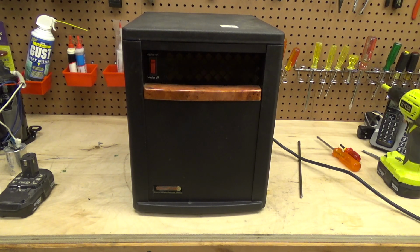It's fairly quiet. The serviceability, not bad. The case got a little confusing towards the end, but overall it's not bad. I really like that the inside is all encased in metal, so should there be some kind of catastrophic failure in there which results in a flame, it's enclosed in metal and it probably won't come up to anything. Whereas if it's in plastic, the whole thing just goes up, which scarily is a pretty common design for heaters nowadays.